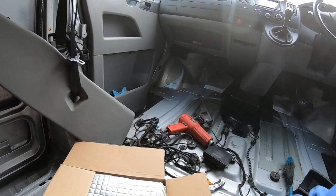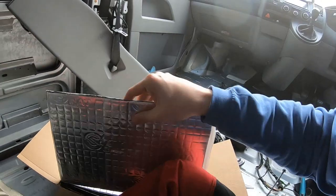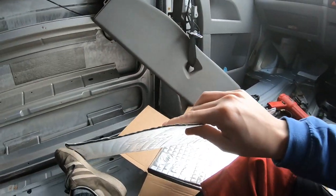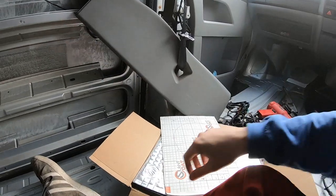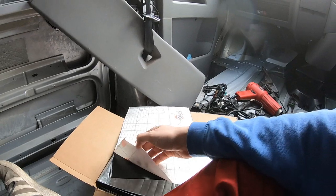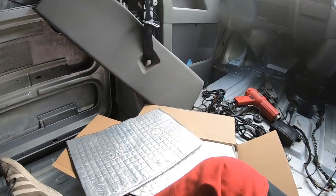Here is the silent coat — there are 40 sheets per box and I have two boxes. You can see it's about two millimetres thick with a nice shiny backing. It's got a bitumen adhesive cover and it's very cold, so I definitely have to warm it up. Warming it also makes it more malleable so it'll bend better into the corners.